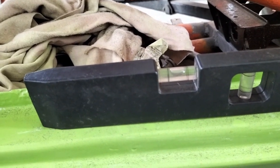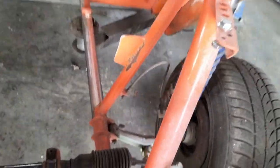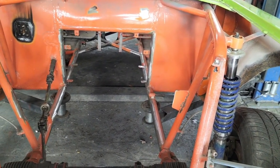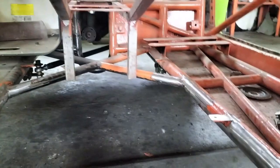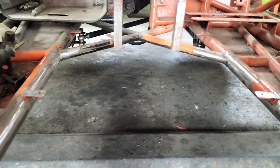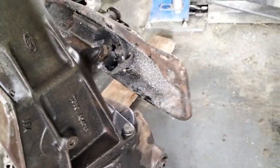All level, ready to rock and roll. What I've done previously off-camera: motor mounts have gone, I've cleaned the chassis rails where I'm expecting to weld, and I've removed the motor plates on that side but left a tab for my tie bar to come across. If it's in the wrong place I'll just whip it off later - it's only about a 10-minute job. The chassis is all cleaned back, I've removed all the nubs of pipe and smoothed the corners inside the crossbars, because I think I'm going to gusset in there with the brackets for the transmission crossmember.